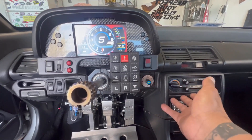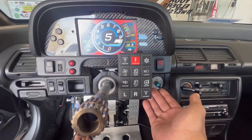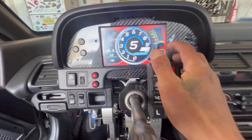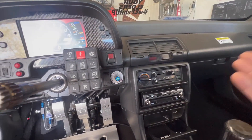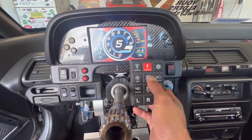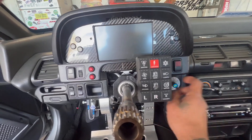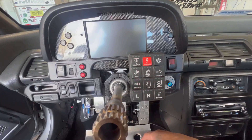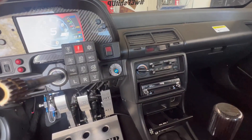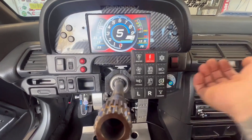I'll show the basics. Fans normally come on through a thermostatic switch — it reads the ECT sensor at 190°F and the ECU triggers the fans at 190. With this PDM system, you can override any of these options. For example, fuel pumps normally kick on during prime — you'll hear them come on and see the two indicators light up, then cut off after prime. That's the signal fed from the ECU, via the ground wire through the C101 plug to the PDM.